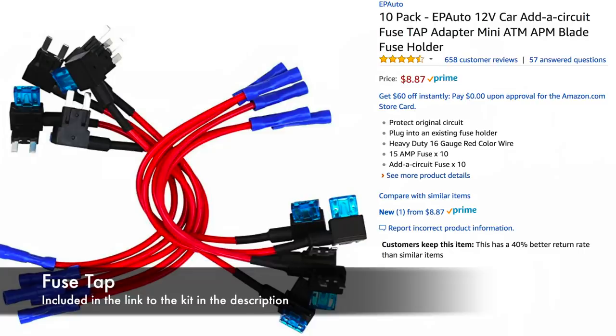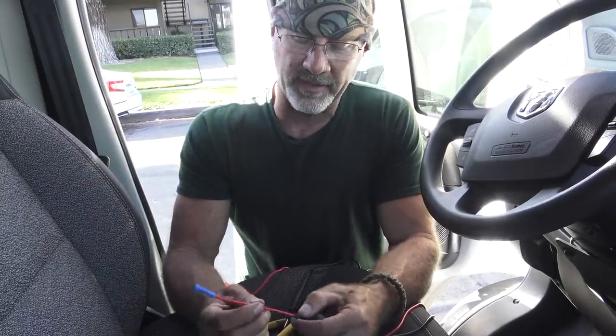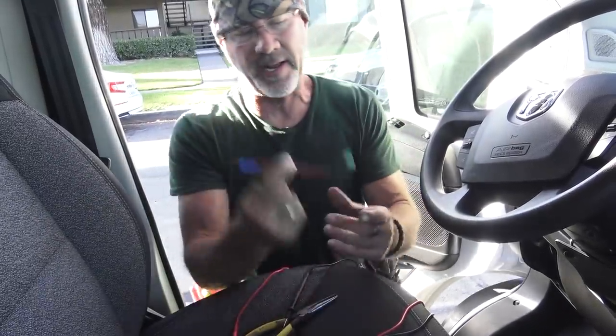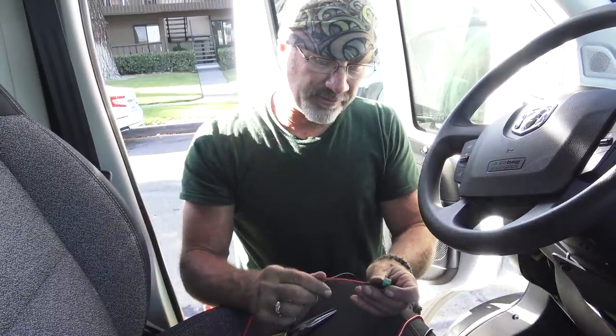And then I'm putting a fuse in to replace it. Now this is a green 30 amp fuse. I could probably go for a little bit less than that. Obviously this wire isn't going to handle a 30 amp fuse, this wire is a lighter gauge than that, but I'm going to use a 30 amp fuse